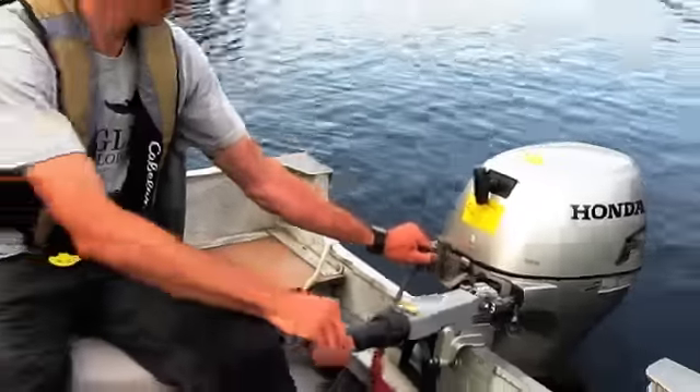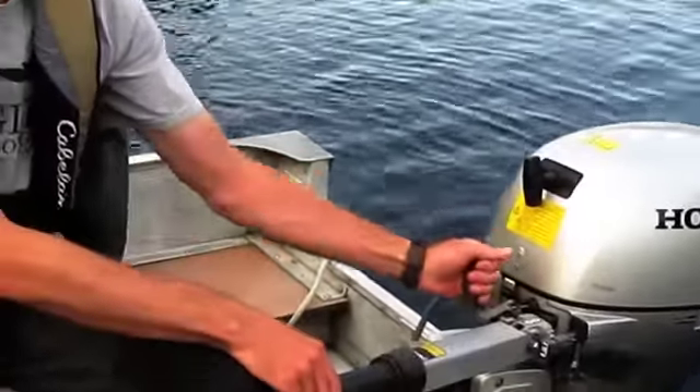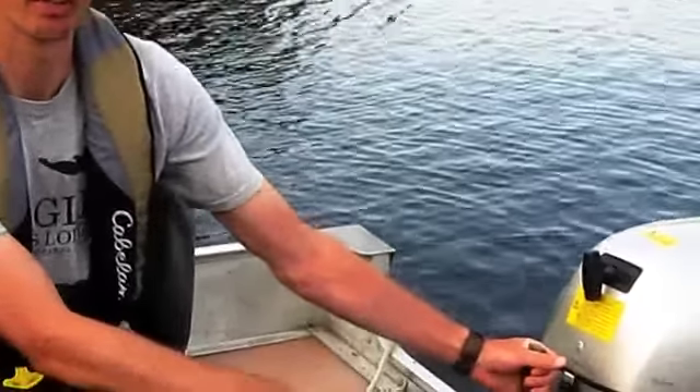When they're cold, we're going to pull the choke out. The choke knob is right here — pull that out towards you to choke it. I like to pop them into forward one click and back, just to know that you're in neutral so we're not trying to start the motor in gear.